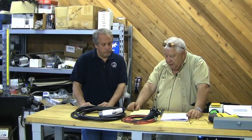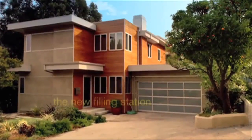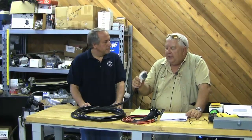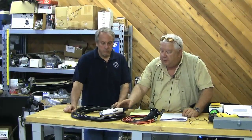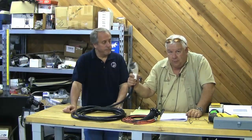Most of the intelligence in here is done by monitoring voltage levels applied across various resistances. By far, most of the intelligence is in this control pilot signal on pin five. Pin five connects to the charger. The charger must do these things or power never comes out of the controller. So if you thought you were going to use this just with a little adapter to a NEMA 5-50, it's a little more advanced than that — you're going to have to do some circuitry in your car or power never comes on.